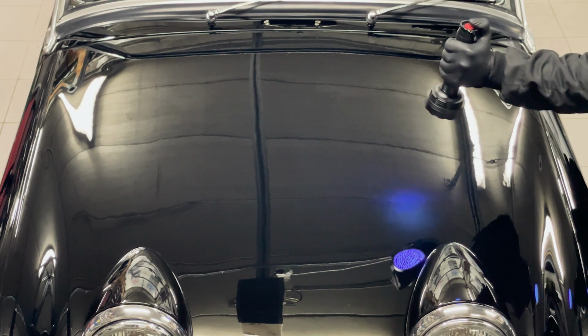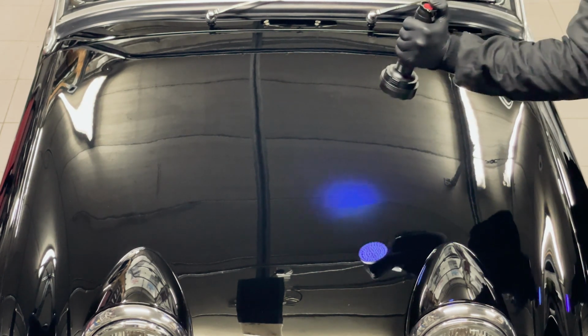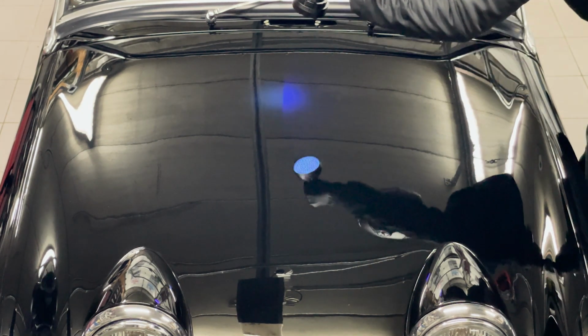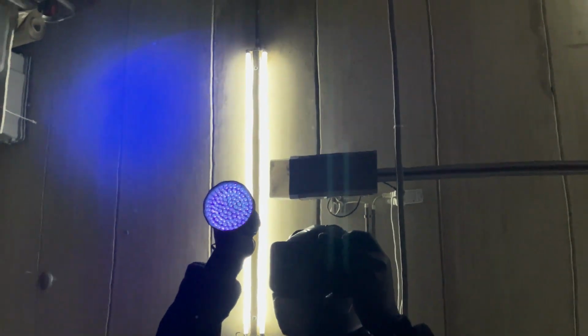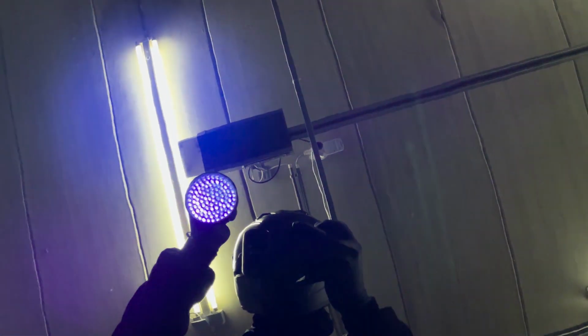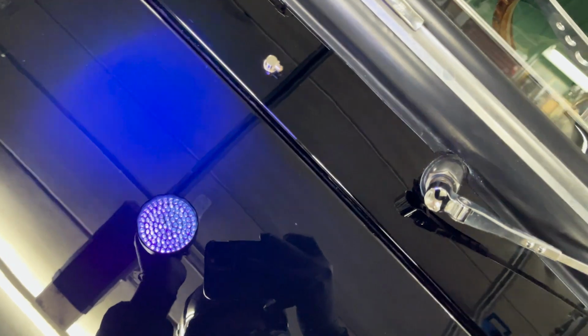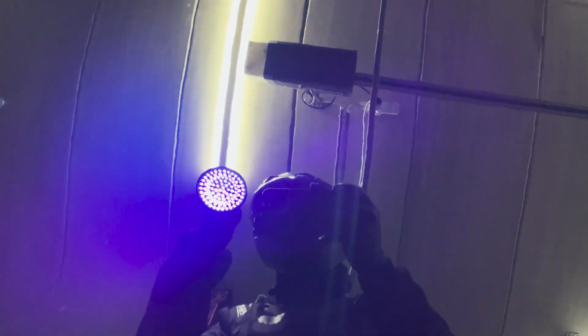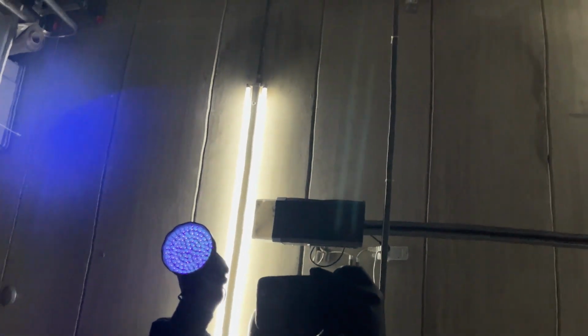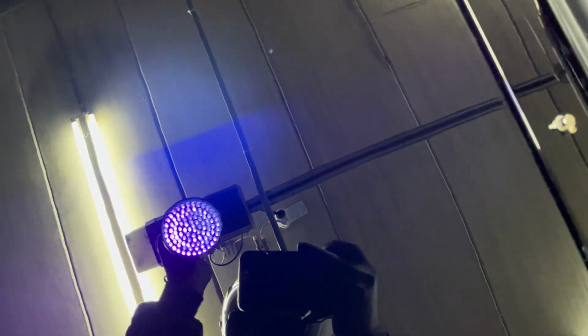You should realize though that the more time the coating has had to cure, the more difficult it will get to correct it. When the coating is fully cured over, let's say, 24 hours, you won't be able to correct it with this technique. The high spots will have to be corrected with fine polish by hand or with a polishing machine. But hey, our problem seems to be solved. The high spot is gone and the coating is ultra glossy and evenly applied. Approved. Time to move on to the adjacent area on the opposite side of the hood for a quick recap.